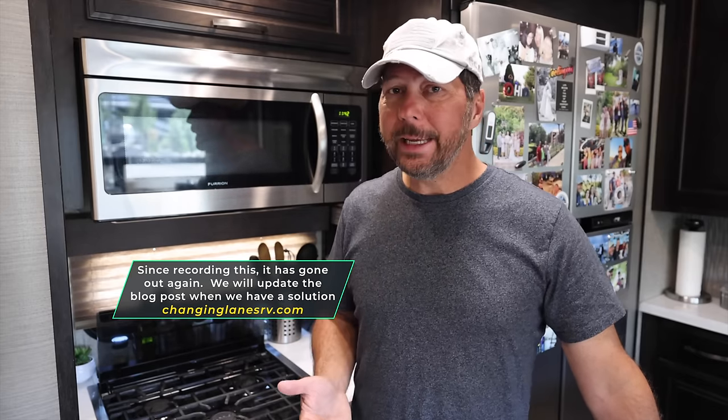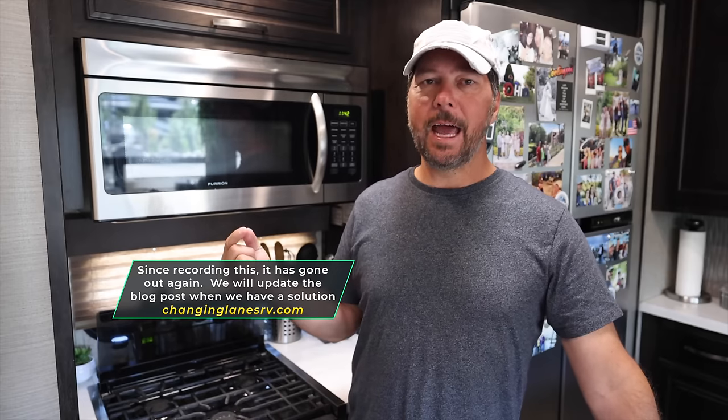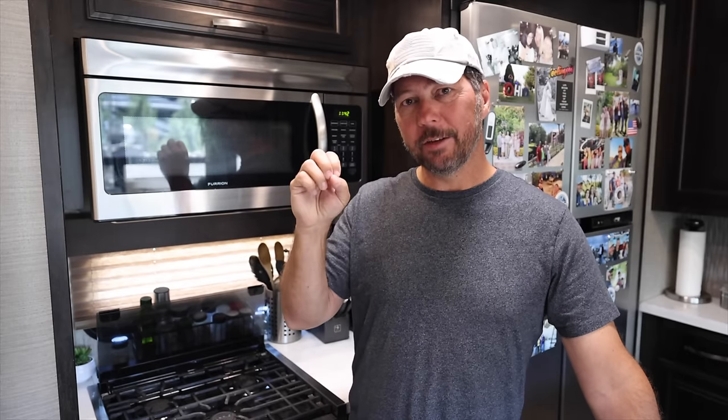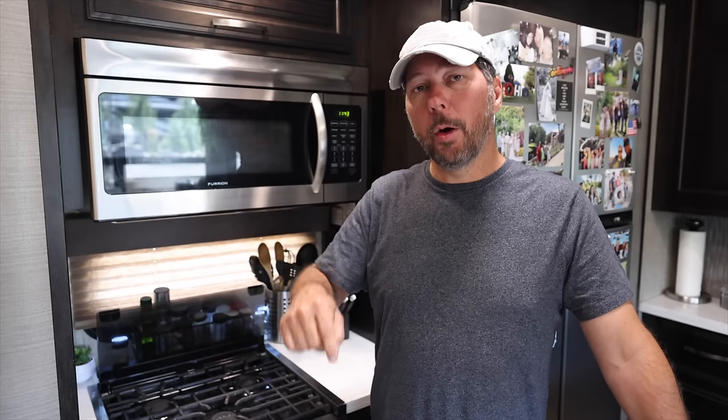So it could be that somehow the leak that I had let air in, it flamed out or whatever. Still doesn't make a lot of sense because there's pressure in the line and it really shouldn't be letting air in because it's higher pressure than the outside. If any of you have had issues with your oven just spontaneously going out while baking something and you found a fix or have an idea, please comment below. I'd love to hear it.